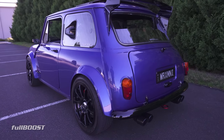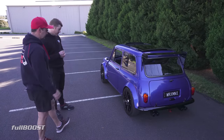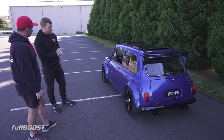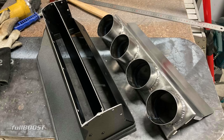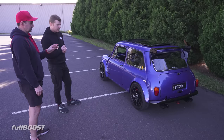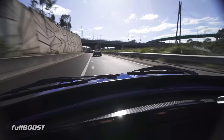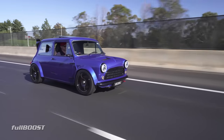So it's a mid-engine rear-wheel drive Mini sitting in exactly the same orientation as a WRX — you just push it to the front of the car. I've put a Process West verticooler intercooler on it — I didn't want a front mount given the engine would be so far up there; the lag would be extreme. So I left the top mount and went with the verticooler, running ducts on the side of the window. Two little fans on the inside keep air flowing at standstill, and when moving, air goes straight through both sides into the intercooler — sits about two to five degrees warmer than ambient.